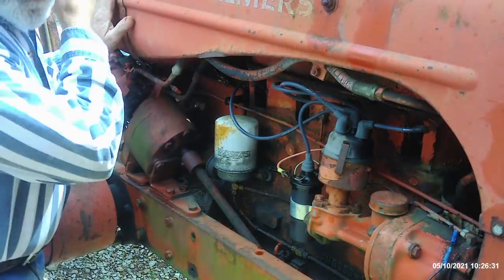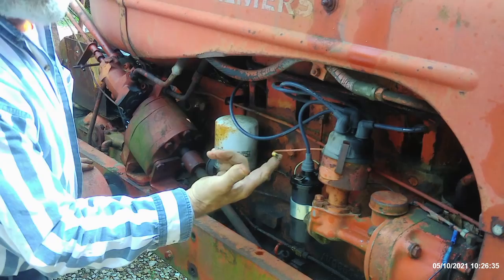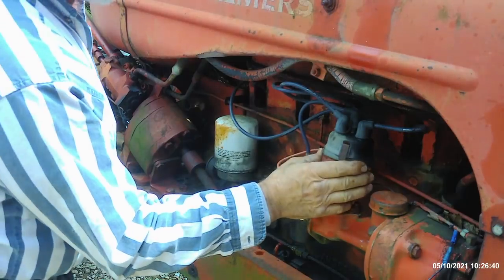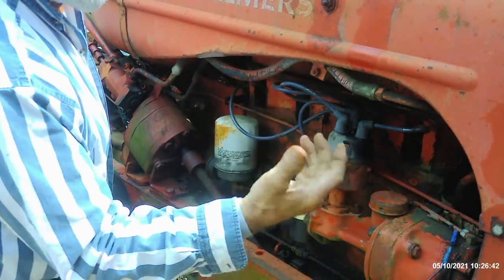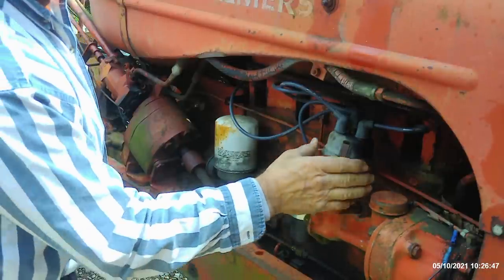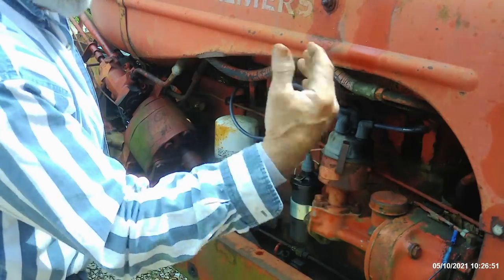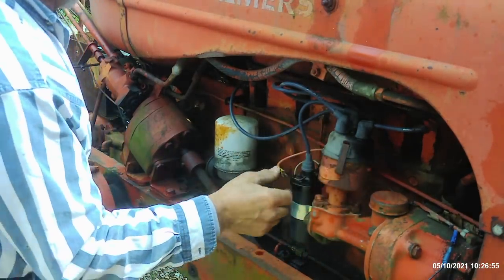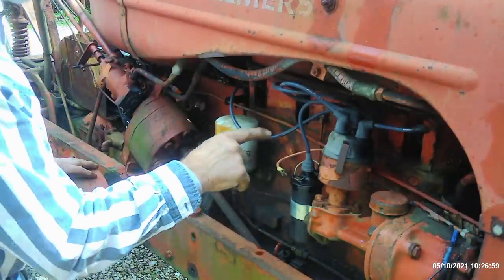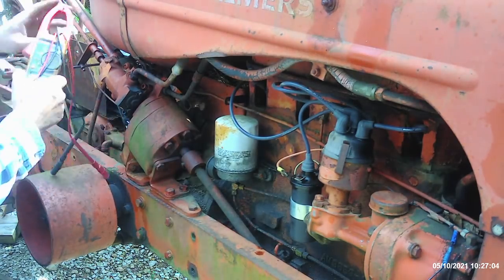Because I don't know what those switches are back there and how they operate, I went ahead and preemptively pulled the wire off of the coil going to the distributor, simply because in case one of them has been on for the amount of time I'm troubleshooting, I didn't want to have the potential for heating up the points if it's in the right position for the points to be making contact and heating themselves up. That's not good. So I've just got the wire pulled off and we can still check for voltage in that position.